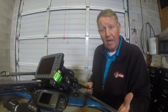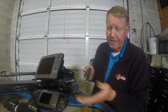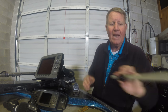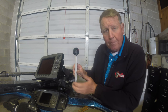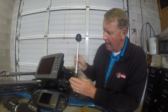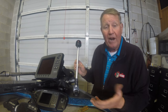It also has two USB ports, and the most important reason I bought this is to be able to power my GoPro camera from the boat battery instead of having separate battery packs when I'm filming or trying to improve my fishing skills by watching what I do on the water. Interestingly, when I bought this, the stern navigation port works fine with this setup, but my front navigation port does not. It has a map light on it, meaning it requires three posts and extra power, so I need to rewire this.